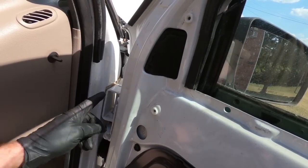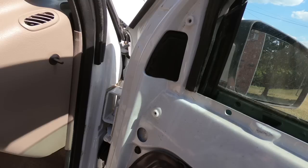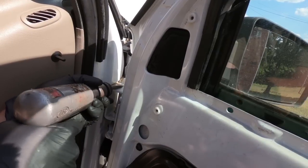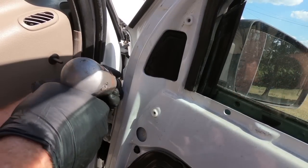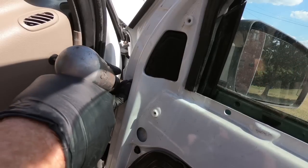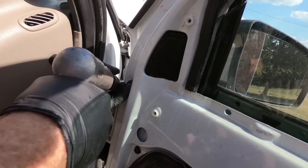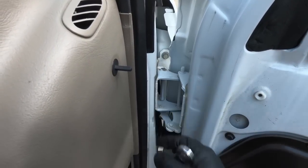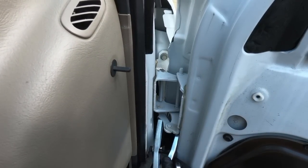So at this point, I've got the door supported. I'm gonna go ahead and see if we can hammer the top of that one off. I've just got a flat blade on the top of my air hammer, and I think it should come out fairly easy. Now that we have that knocked off, I'm gonna use my little spring compressor here to try to compress this